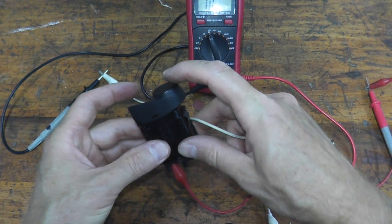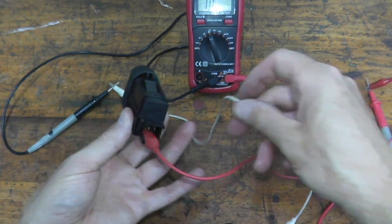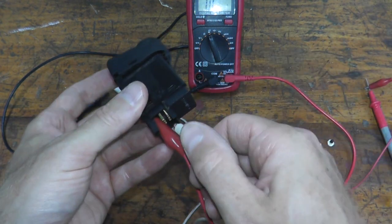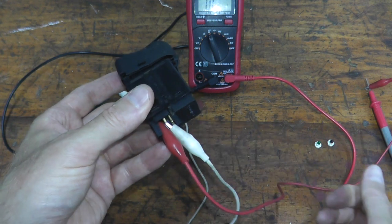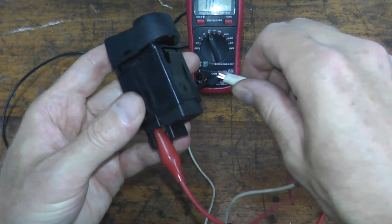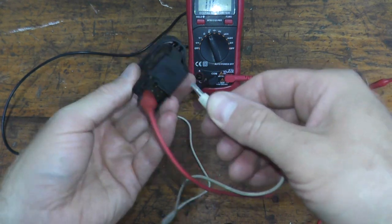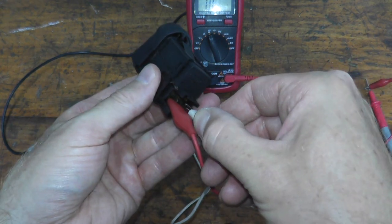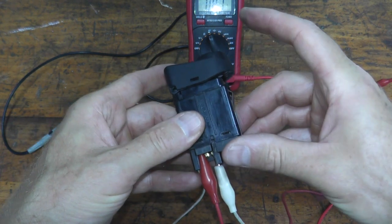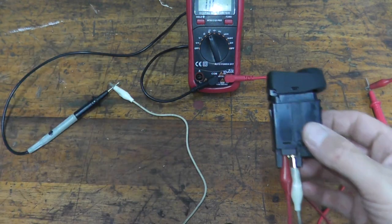And I'm turning on the switch, okay? Pressing it down. This is engaged. That's not engaged, or the system is off. So let's pretend that this is in the vehicle, press it on, and let's start. We should hear continuity if the switch is good. So let's start with terminal 2. Okay, nothing. Terminal 3. I can get it in there. Terminal 3, nothing. Terminal 4 doesn't exist. Terminal 5. Terminal 6. Okay, so this switch works, which tells me I have a problem with this guy, which we'll find out.